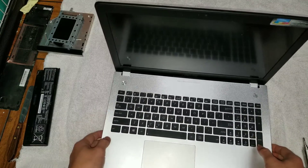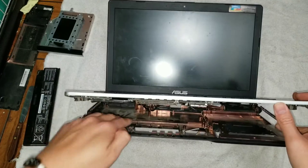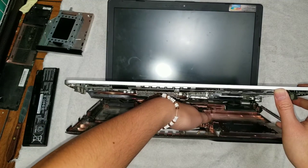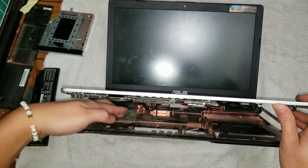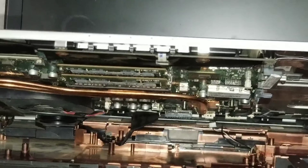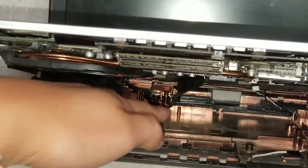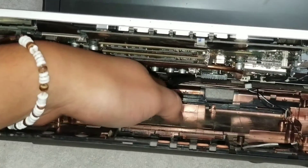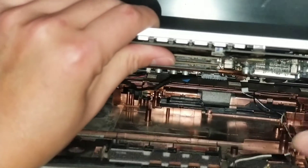Be very careful with this — here's where it gets to the pain in the ass part. Once you open this up and look inside, they got the display cable going right under here, and then there's this other little cable which actually unplugged earlier but was a pain to put back. First what you do is you kind of have to adjust this a little bit. This little cable is a pain in the ass to put back, and then this one also — to get it guided through where it's supposed to go — is also a pain. To remove it, first you gotta pull this out so that it's not clipped under this little plastic piece that holds it there, and then remove that.